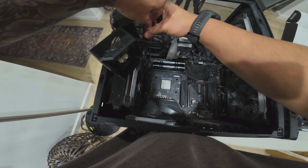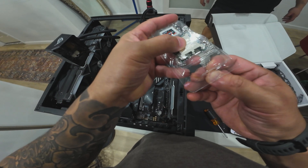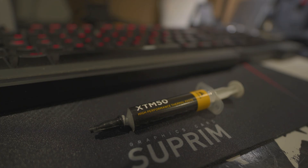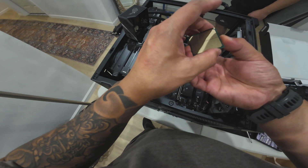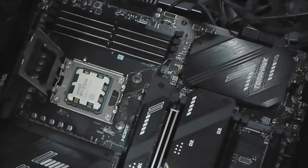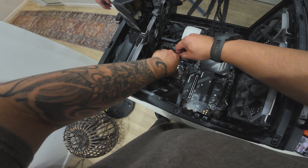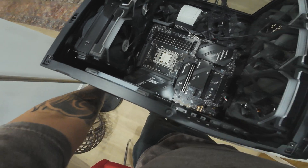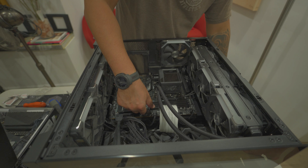At this point we have put in our motherboard, tightening it up with the screws — first gently, just to seat everything. We've got the CPU now. We are using our Corsair XT-M50 to cool down our CPU. It's very important that you align the arrows from the CPU to the motherboard on the top left corner — it must be aligned. Now you can close it; there's a tension in this one. The CPU generates a lot of heat, so it needs to be secured properly with this tensioner. We're putting the thermal paste in and installing the cooler, then doing a quick check for any loose connections.